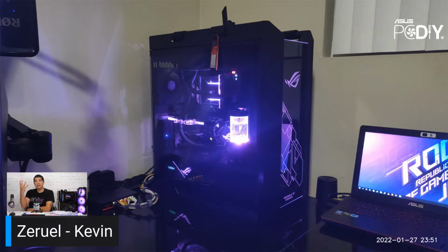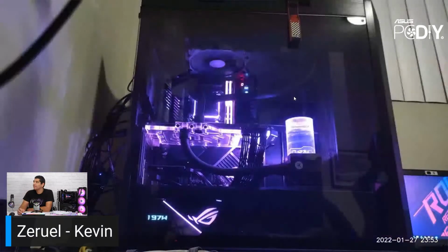My preference when it comes to water cooling is soft tubing. I know the trend is hardline, but soft tubing is cheaper, it's easier to maintain, it's easier to correct and adjust. And it offers you the same exact performance and it can still look cool. So for me, almost always, I'm going to prefer soft tubing unless you really have a purposeful perspective on what you want to achieve with the hardline. So very cool, nicely done right here.